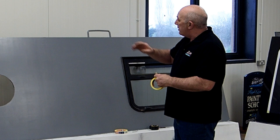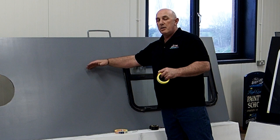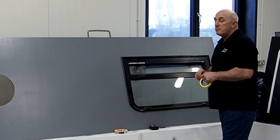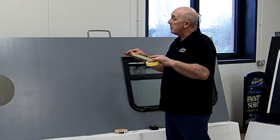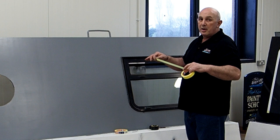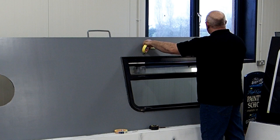I'm working on an undercoated surface — it's just the way we do it. We prep the surface, then put our coach lines on, and then put the colours above and below the coach lines. It's not everybody's way of doing it but we find it works for us. It's important that the tape I use is very high quality and leaves a nice clean edge, and is strong enough to peel out once you paint it. This is Tessa precision tape — very, very good, one that we've worked with for a long time.